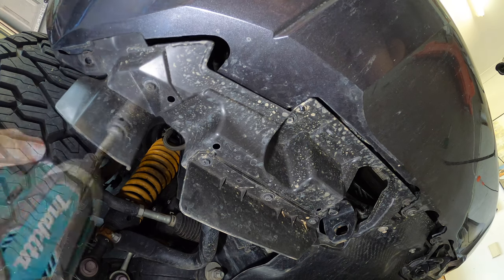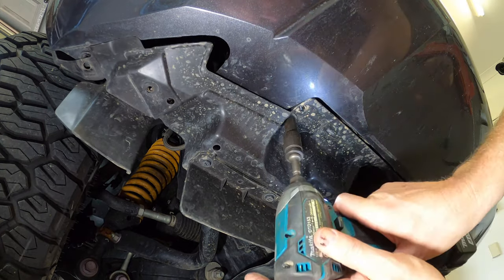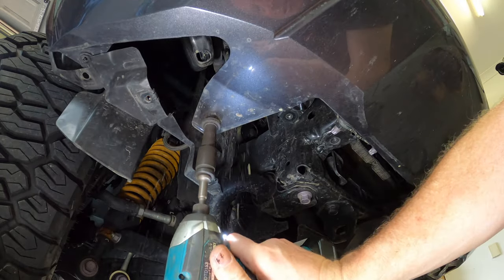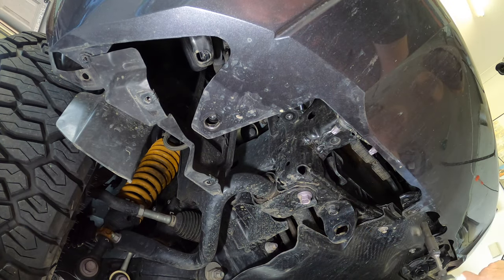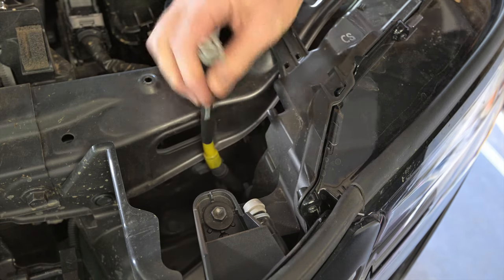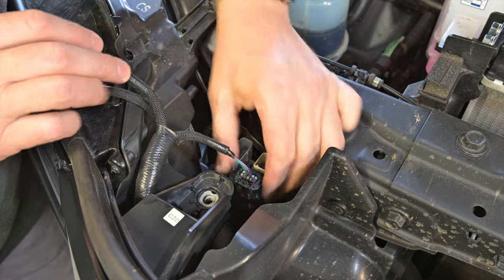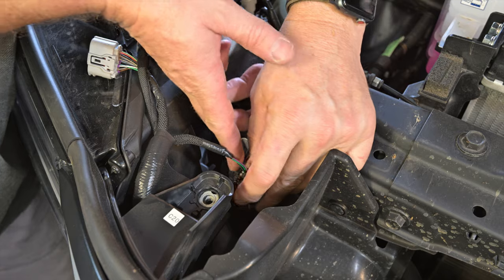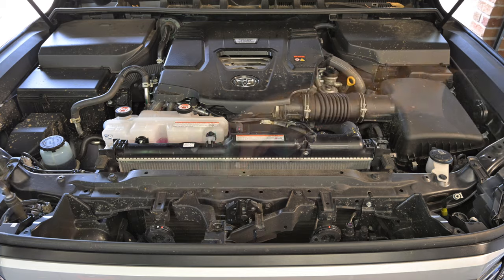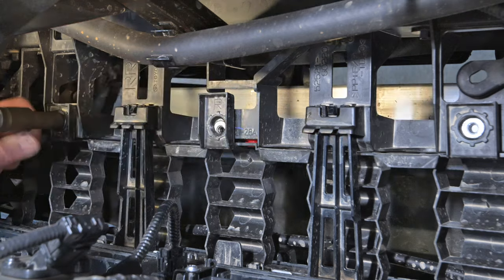Now move under the vehicle and remove the two front splash trims under the bumper, one side at a time. They're secured by several 10 millimetre head screws plus a 12 millimetre plastic nut. Once the trims are removed, remove the four bolts securing the bottom of the main bumper using a 10 millimetre socket. Now move back up to the grill and unclip the headlight washer hose on the passenger side. Then move to the driver's side and unclip the three electrical plugs which supply the front camera, radar, parking sensors and fog lights. Then use a 10 millimetre socket to remove the three bolts securing the top of the grill. Then move down behind the grill and release the three bolts securing the bottom grill support bracket.